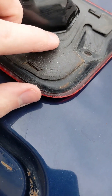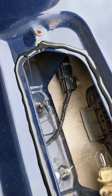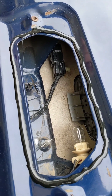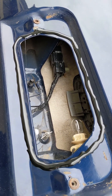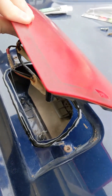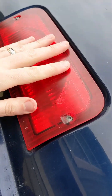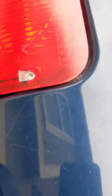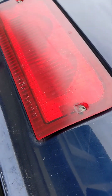I'm going to try the tube on the existing gasket. I cleaned up the surfaces really well, washed the gasket and the surface. We just used our weather strip adhesive and did a ring around the opening. These are blind holes, so water, if it gets down in there around your screws, can't come out on the bottom. We pop the bulbs in, twist them into place, flip the light back on. We got the bulbs snapped back in place, set this guy back in, and got the screws in. You can see the black weather strip adhesive oozing out all the way around.